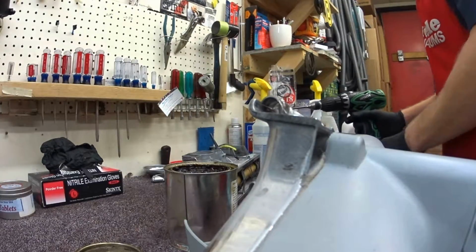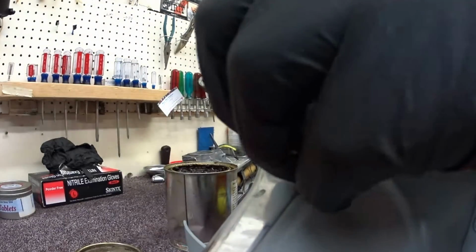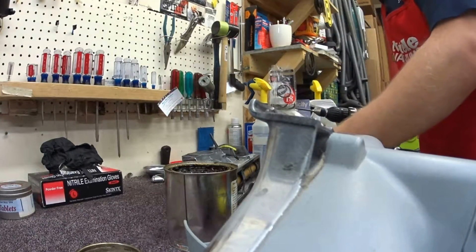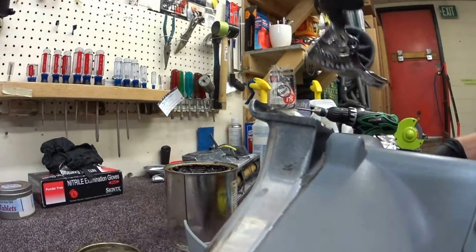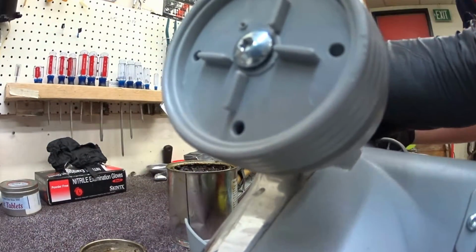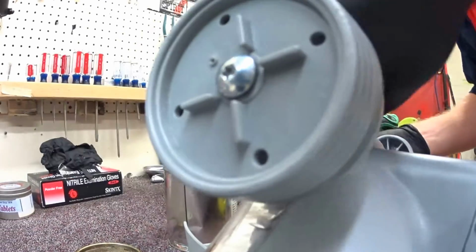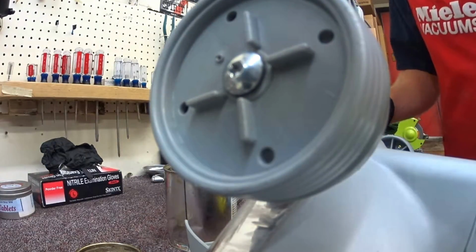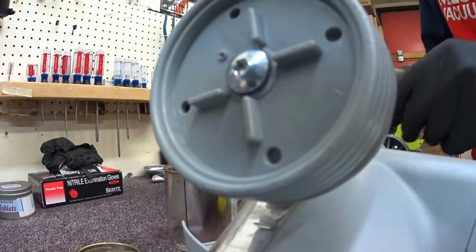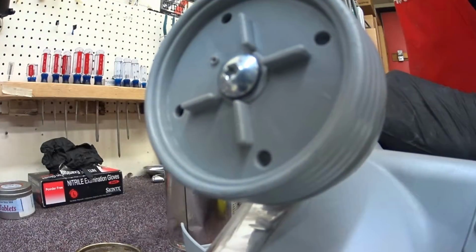So next, real quick, I'm just going to loosen these screws up. Again, this is steel on aluminum, so sometimes these screws up here will get seized. You just got to be real careful not to over torque stuff when you're working with these, because this aluminum that these are made out of is actually quite fragile. I would say I've seen just as many technicians strip the aluminum as I have strip and break plastic over the years.